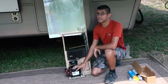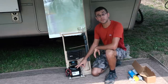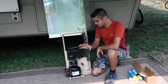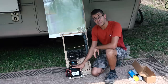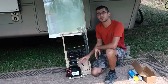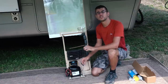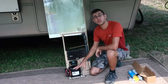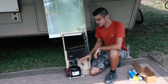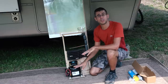This is a DC model — they also make an AC model. We chose DC because it can utilize 12 to 24 volts. Our RV has a 24-volt battery so we'll use it on 24 volts, but you can also use the existing 12-volt leads from your current fridge. This compressor is incredibly efficient: it draws around 60 watts, while our current heating element draws around 400 watts. The 120-volt version draws around 80 to 100 watts — still a fraction of what the existing propane-electric unit uses.